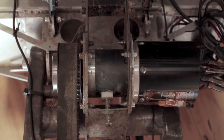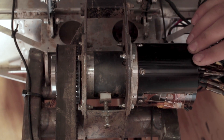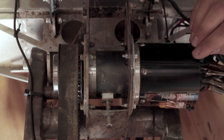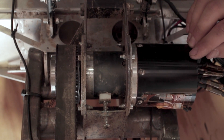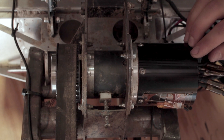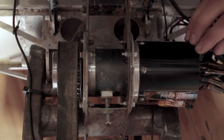You're looking at an overhead view of the electric drive system — forgive the mud and crud, it's been out on the trails a lot as we've been testing it. The electric motor is here on the right; it's a brushless motor. In low range it'll spin 8,000 rpm and in high range about 13,000 rpm — a really incredible little motor. It weighs only about three and a half pounds but puts out a peak of about five horsepower.